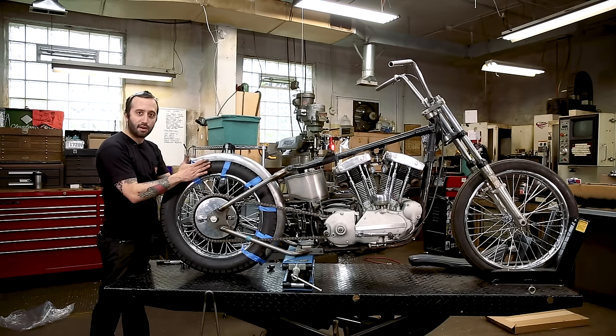So now that the holes are drilled in this plate, we're going to bolt on the bracket that's going to mount the fender to this plate. As you can see, I'm using flathead bolts like the rest of the hardware mounting the fender, just to center my holes up. I also will be putting a couple washers underneath this so that after everything's painted, you're not going to have such a huge surface smooshing your powder coat or your paint.